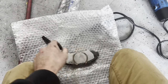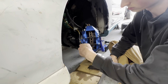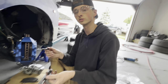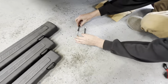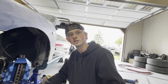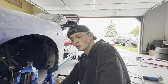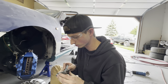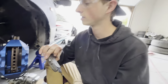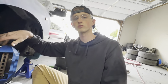We're going to remove the retaining pins for the brake pads — there are two 10mm nuts, one on each side, and 5mm hex keys on the front. I'll keep upper and lower specific just as a habit. I also like to screw the nut back on the whole piece so bolts don't go flying across the shop. Since this brake pad was on the backside of the rotor, I'm going to put it back on the backside — believe it or not, that does matter. Put the shim back in the exact same spot you found it.